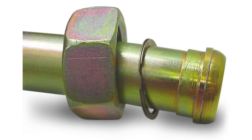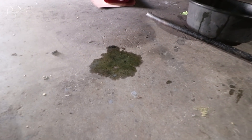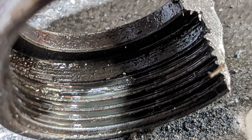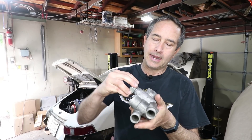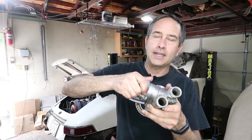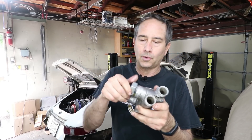The biggest issue we have to fix right now is an oil leak right at the thermostat. I've ordered some clever parts from Elephant Racing that I think are going to allow me to snug up the lines without damaging any of the threads. The issue was the old nut had damaged or ovalled threads and wasn't allowing it to clamp right. I've gone over the threads with this new nut from Elephant Racing and now these just screw right on with no friction, all the way down to the bottom for all four oil connections - that's going to give us maximum clamping pressure.